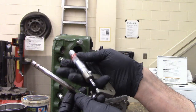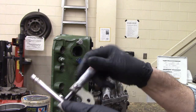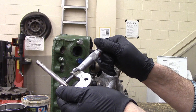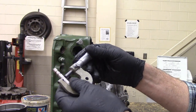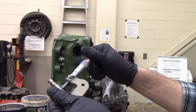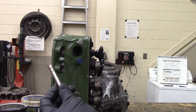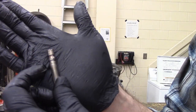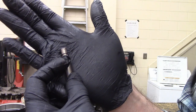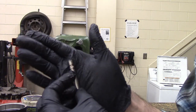You're going to use your micrometer skills to measure the worst wear on the worst-looking valve. It might wear badly here, it might wear badly there, but you're going to find the worst spot, measure it with a micrometer, and see what your specs are and compare that to whether it's good or bad. Sometimes you'll find someone has different valve stems in here than what you're expecting. There's two grooves on these Chevy valves. The top one is what the keepers go into. The bottom one is where a little tiny rubber O-ring goes — and that little tiny rubber O-ring is all Chevy used for an oil seal back in the day, other than this little tin cup. Not the best, but it's what they used forever.